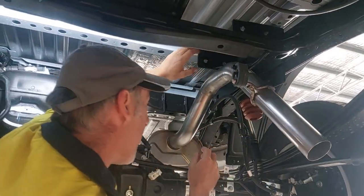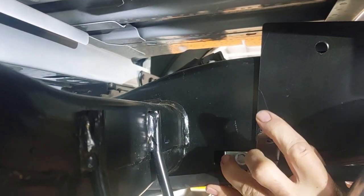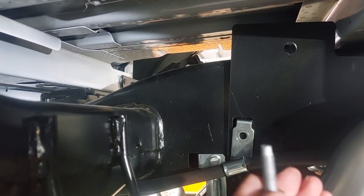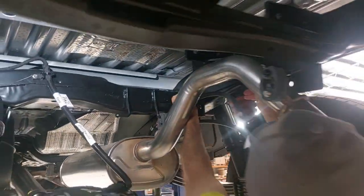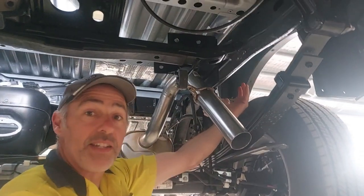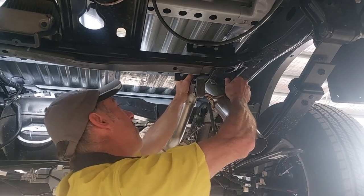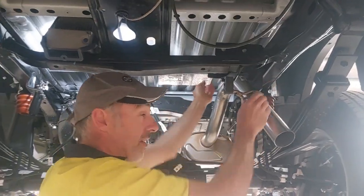Once it's in, if you come in here and have a look — there's a square that we've put in for the chassis. That tag goes in the square like that, and the bolt that was in there goes back in the hole. That pretty well lines it up in position. Then you install your two U-bolts from where the inner guards come out. You put the U-bolts through and there are four nuts you put on on the inside, and that sits up really hard against this top hat. So that's the driver's side bracket.